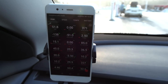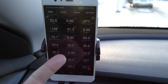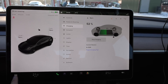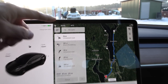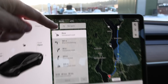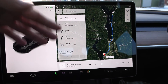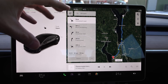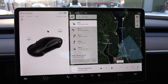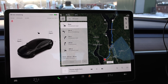Battery temperature is 20 degrees. I think I will charge up a little bit more — it might be 25 by the time we start. The plan is that we will do 120 km/h tests. This is a range test, and it's minus four degrees Celsius outside. We will drive north at 120 kilometers per hour and then back, measuring only consumption. On the next run, we do the 90 km/h test and actually measure battery capacity.